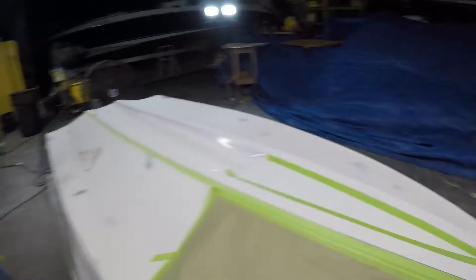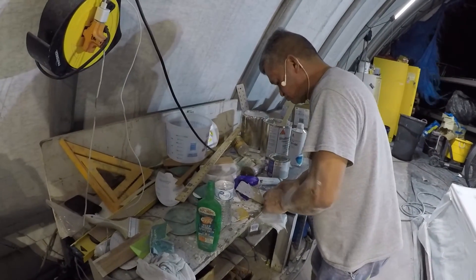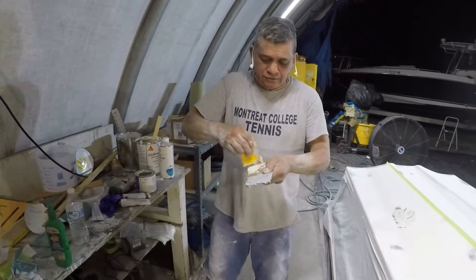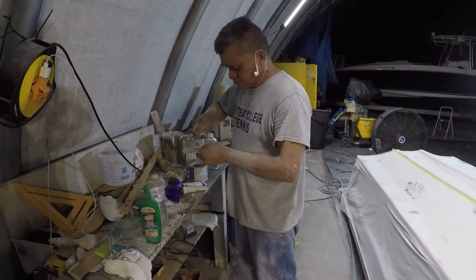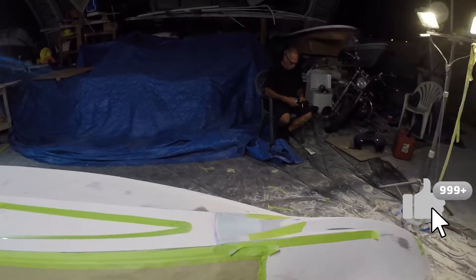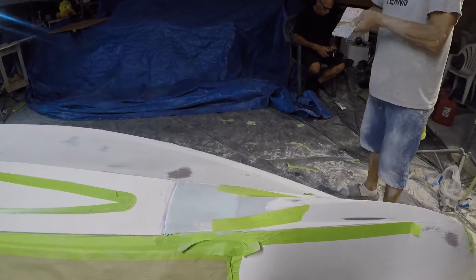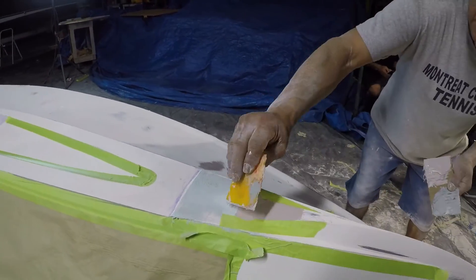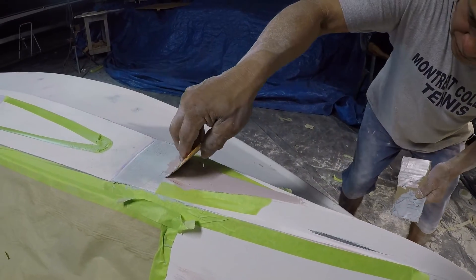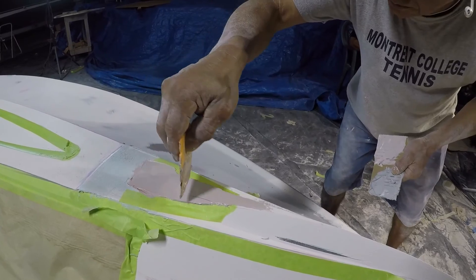This was originally P77 and now he's going to use Evercoat with a different color. We're using the Evercoat because it dries quickly — we're having some issues with temperature. Temperature plays a factor when putting in hardeners: the colder it is, the more hardener you need; the hotter it is, the less hardener you use. Remember, the P77 is for building up, and the Evercoat is like the finish epoxy.